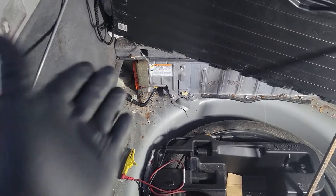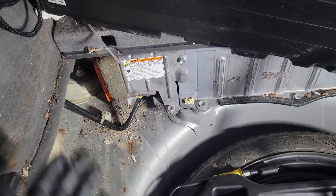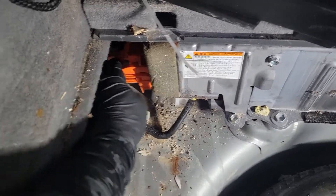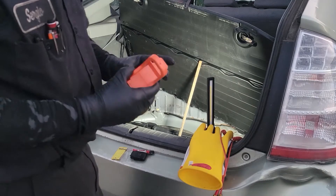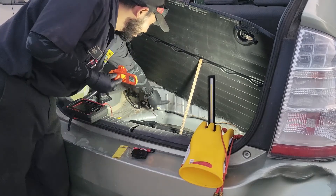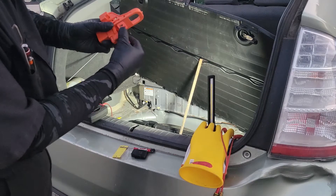One of the things you're going to want to do is disconnect the hybrid service plug. I've already tested this vehicle so I know it's safe — I did all this with my gloves before. In a normal situation you want to wear those gloves. If you've never disconnected this, it's pretty easy — basically you pull up on it, push forward, and pull it out. That's your hybrid service plug. This is rated for 125 amps or 450 volts, which is pretty high and could kill you. When you go in after taking the protective cover off, be very careful — you don't want to touch these two leads. You're basically connecting yourself right to the battery and you'll die.